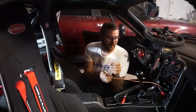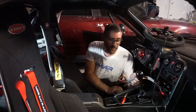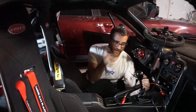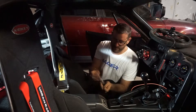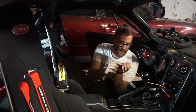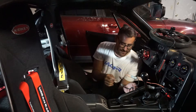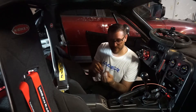With that all locked into place, we can take this and plug it in here. Our wideband is almost connected — that was the AQ-1 connecting to everything else. Once we connect these four wires and those two wires, then and only then will we be done. We're using these Y-harnesses that AEM sells, which you can pick up. Basically, we're connecting all of these gauges in AEM net to make it easier so we can read everything as a whole. Now we're on to the female DTM connector and we'll go from there.